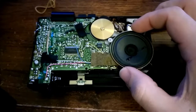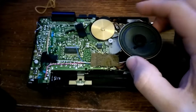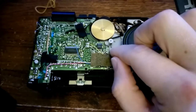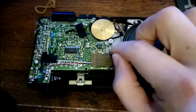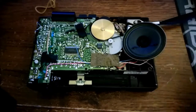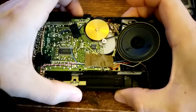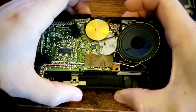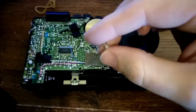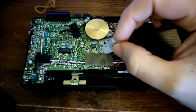This white cog here is what controls fast-forward and reverse. It has a belt on it, but this belt is actually too loose — it came from the other one. I swapped belts on them when I got them; it was cheaper than buying a new belt kit. This thing locks in and locks out — it lifts up and pushes over to the right and left. There's supposed to be a little ring that holds this plastic piece on, but because it's plastic and this is from 1987, it eventually cracks.